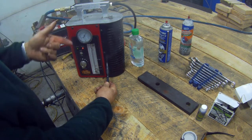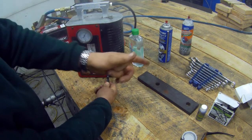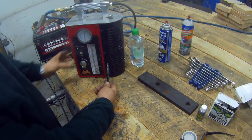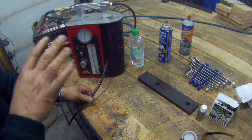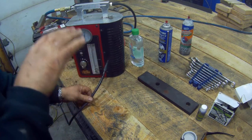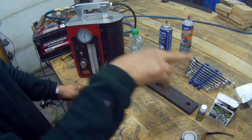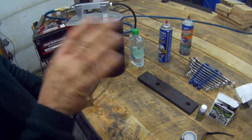What I do with engines is I block off the intake and I also block off the exhaust manifold as well, because sometimes this smoke is so fine it can get around the pistons or the valve guides and then go out the exhaust or through the intake. So you want to make that engine block as airtight as you can. On a 300 TDI that means taking the breather off and putting plugs on both sides, because you don't want smoke going down through the turbo and tracing a leak that isn't there.